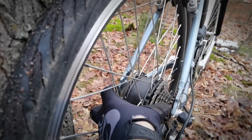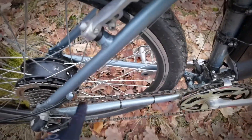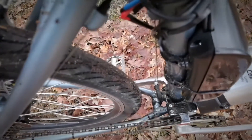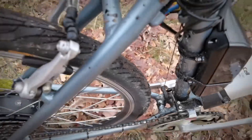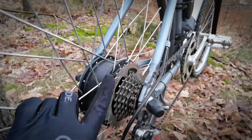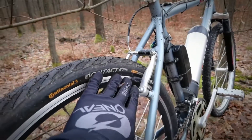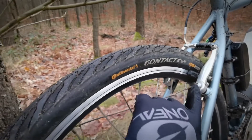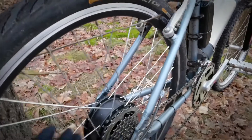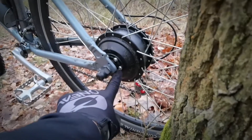If the axle from the conversion kit was a little bit too long, you can always stretch your frame a little bit — that's no problem. Also about the chainstays: you wanna have the right length of the chainstays so that you have enough space for the wheel — as you can see, there's plenty of space here. You wanna know how many gears you have and whether you have the cassette, the free hub, or the freewheel. This one is the freewheel version. And finally, you wanna know the type of the brakes. I needed a rim for the rim brakes because I don't run disc brakes on this bike, but you can easily buy something with disc brakes.